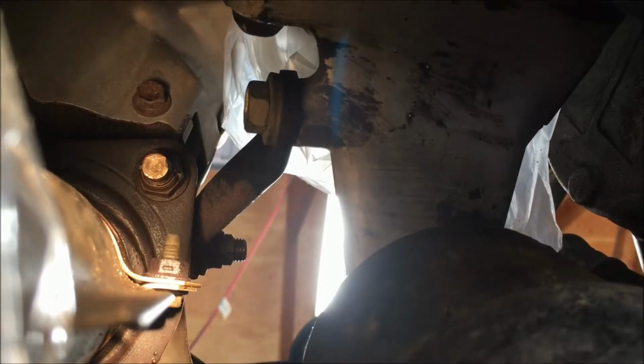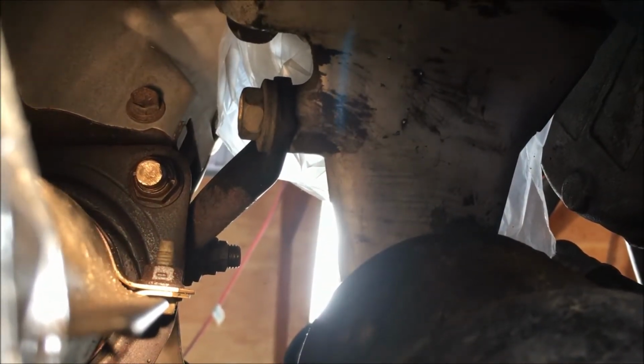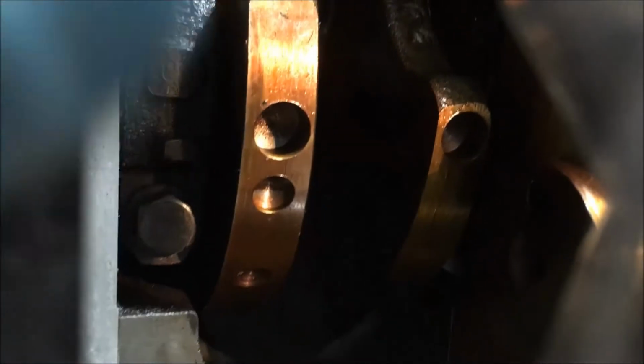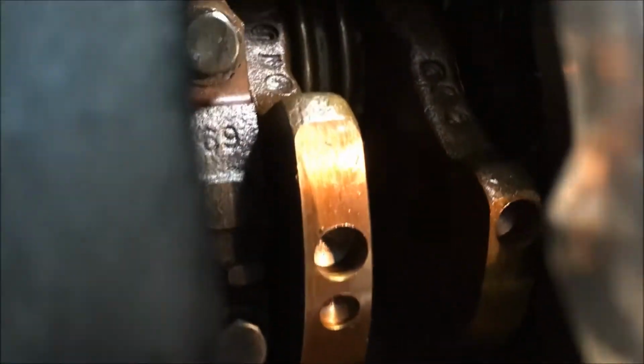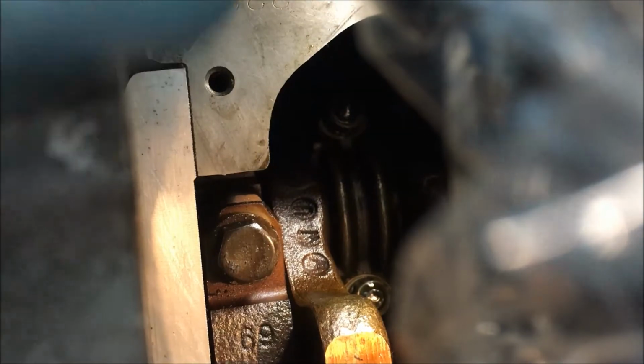That's the exhaust in the way right there. The 14 millimeter to drop the exhaust a bit so I can get the pan back in. So I could get it out with a struggle, but I can't get it back in. Now, people far smarter than me can probably do this without dropping everything. But unless you drop the exhaust, that will get in your way and take off the sealant. And so will the mating surface right there.